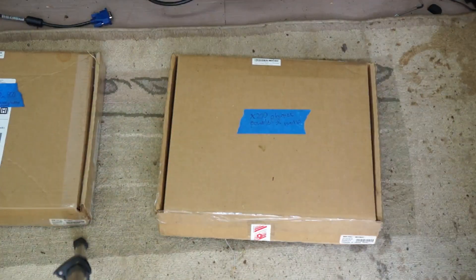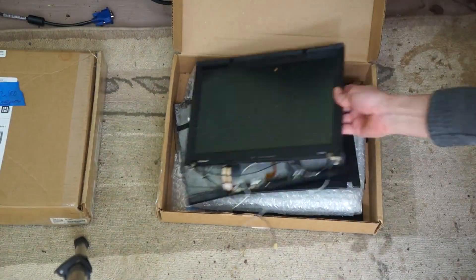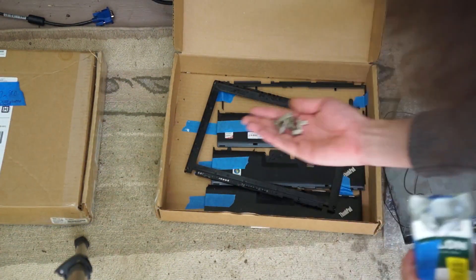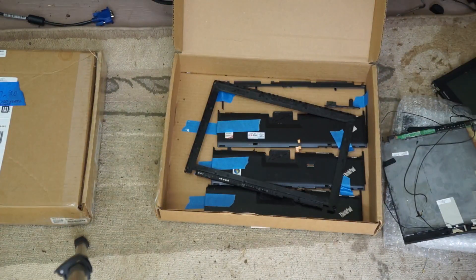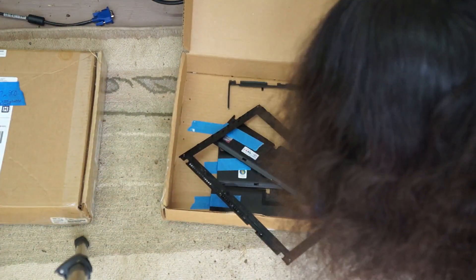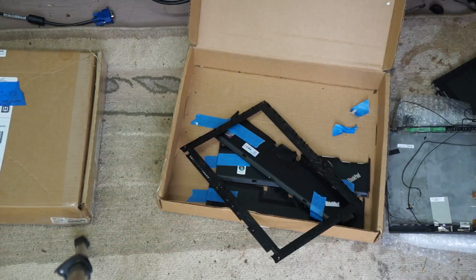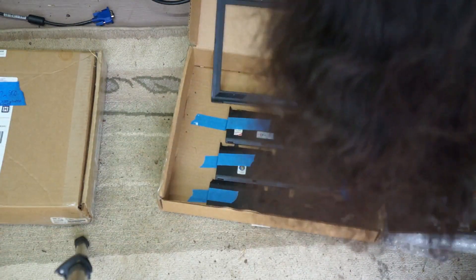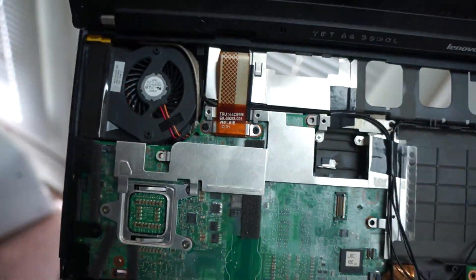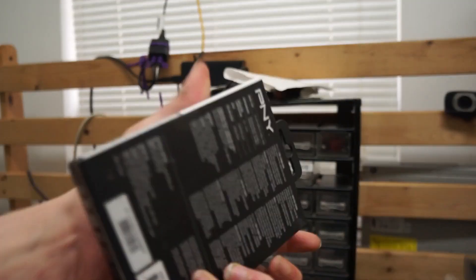Check the BIOS version and get some extra plastics out. Most of the plastic pieces I have nowadays are chipped. I have some spare hinges from some screen repairs. After that, you can pull off plastic parts from storage — be careful about the one piece because that's the easiest piece to crack on the entire X200 during disassembly. But if it does crack in the way it's cracked there, it just goes back on relatively normally and isn't really noticeable unless you have to take the computer apart again.